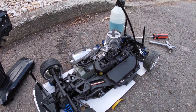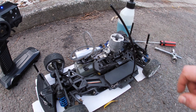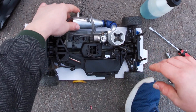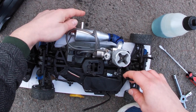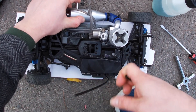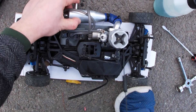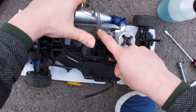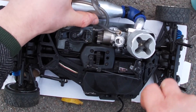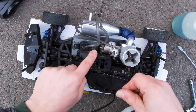I've got my 25% nitro fuel that came with my Savage XL K 5.9. Hopefully there are no vacuum issues. A lot of times when I've rebuilt carbs, there's still something going on. The most important thing is seeing fuel come through the fuel tubing — if I don't, that means there's a vacuum leak. I'm holding the exhaust plugged to check. I can see a couple of bubbles at the outlet forming but not traveling anywhere close to the motor. I kind of see a vacuum leak already, and there's oil and fuel around the top of the gas tank — not a good sign.